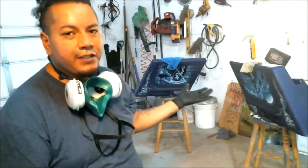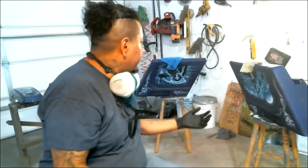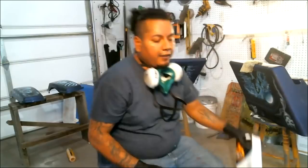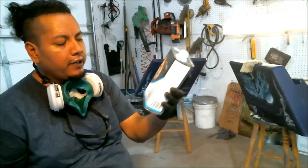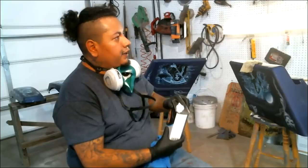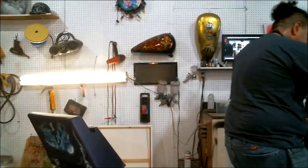What's up, guys? Here we are, day three. We got all our artwork done — everything's nice and ready and we're ready to put some clear coat on it. But first we've got to clean it off and get it ready for clear. You're going to need a microfiber cloth like this one. You've seen me use alcohol before doing the art, but before clear I like using an actual wax and grease remover. For that we have this Wipeout Surface Prep — be careful, there's some that are wipe and some that are spray, so make sure you get the right one. You're also going to need a tack cloth. After wiping with this, we need to go back and make sure we get all the fibers off that the microfiber cloth leaves behind.